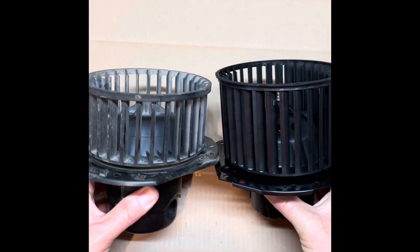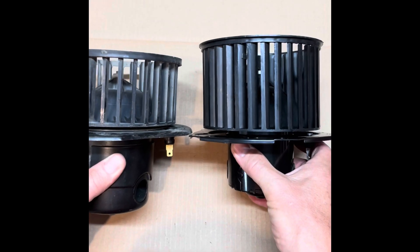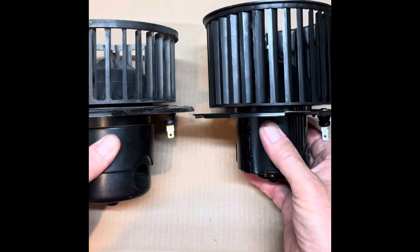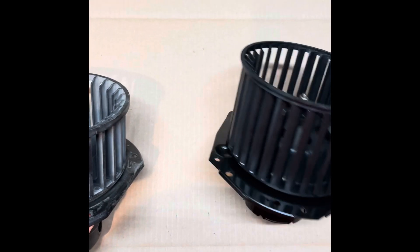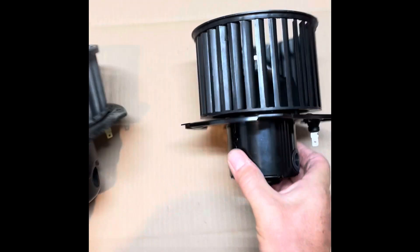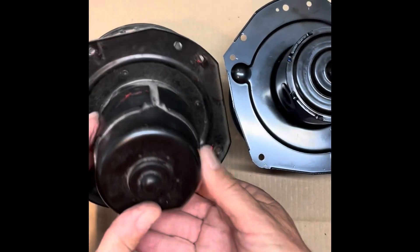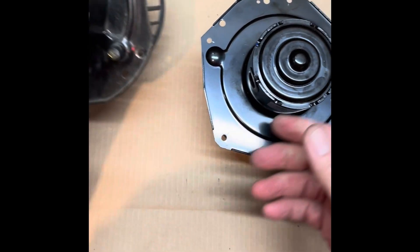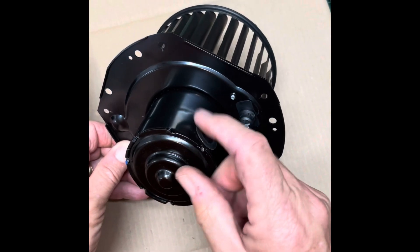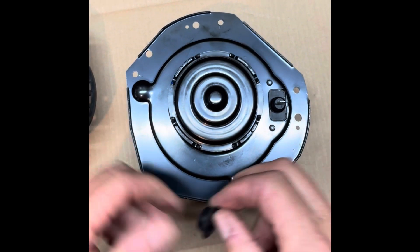Here's a comparison of the two motors — old C3 motor and new C4 motor. The new motor is actually seven-eighths of an inch longer than the C3 motor and squirrel cage, so the adapter will have to be made to fit that. I also bought some extra gasket maker material, one-sixteenth of an inch thick — I'll put it on each side of the adapter to get our seven-eighths inch clearance. The motors don't look 100% identical on the back side, but the bolt holes will line up. I put a mark on the top of the old motor to keep in mind its orientation when putting the new one in. The new motor has the same single-pole connector and the fresh air line plug falls in the same relative spot, so that's all looking good.